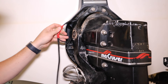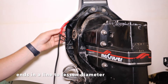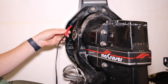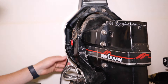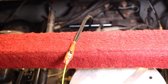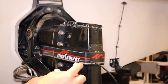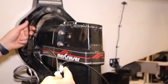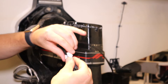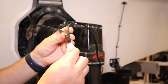While trying to pull the trim sending cable through, the weed whacker string came out. So I tied the trim sender cables to the trim limit switch cable I'd already got through, taped them together, and pulled on the trim limit switch to bring the other cable through with it while helping it from this side. That did work — I was able to get both cables through. So now that we've got both cables through, each cable has a half-plug just like the old ones, and I'll need to make sure they seat properly up in there.